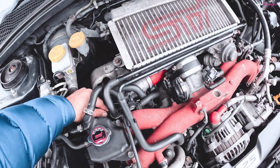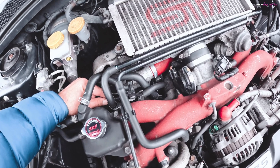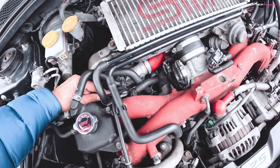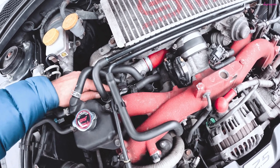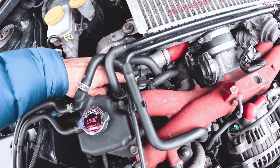As far as the map is concerned, I've taken the wastegate duty down to zero, because I don't want anything more than wastegate pressure — which on this turbo is about half a bar, or 7 psi of boost. Equally, you could do that in the engine bay by putting a straight bit of vacuum hose from the turbo compressor outlet to the wastegate, and it'll run no more than wastegate pressure. On this car I've got a three-port boost solenoid, so to reduce boost down to wastegate pressure, just take the hoses off from the turbo and the wastegate and put a straight bit of hose between them.